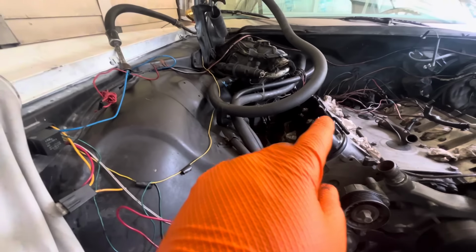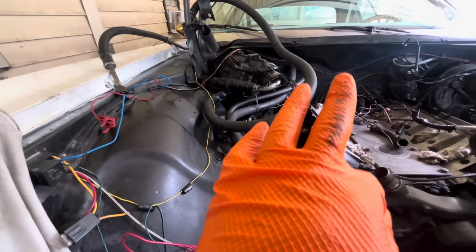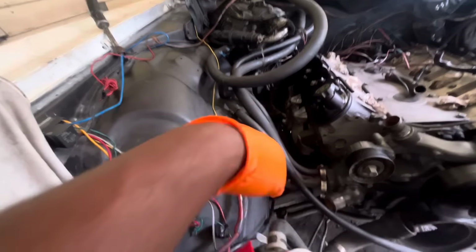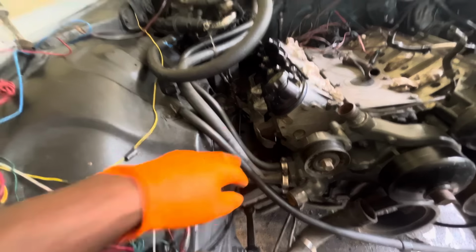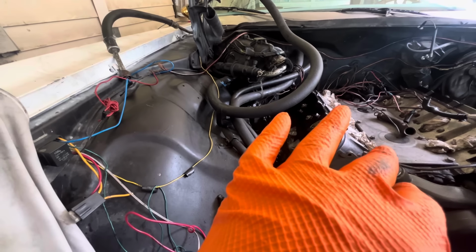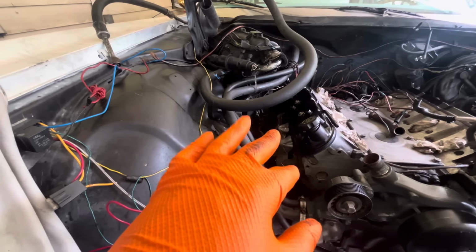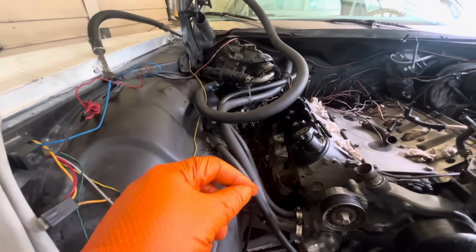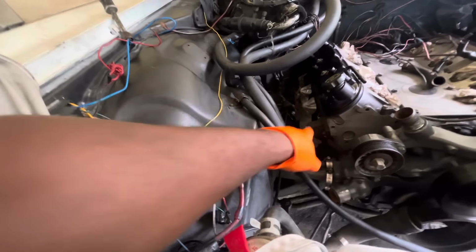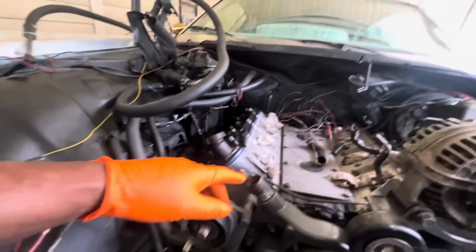So we're gonna have to run the gas tank out of a bubble Chevy, which is gonna have three prongs. One is the feed line, which I'm gonna hook up to this feed line here. The other one is probably the return line, which I'm gonna have to make. Then I'm gonna have the other one open for a vent, which I'm gonna run a hose up to the neck of the tank. And the return line I'm gonna run through here as well, but I have to see where I'm gonna mount my regulator.